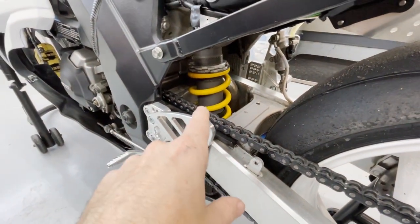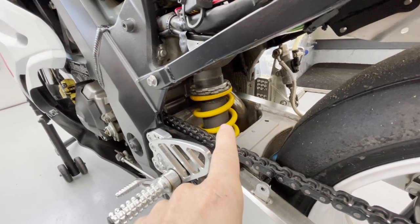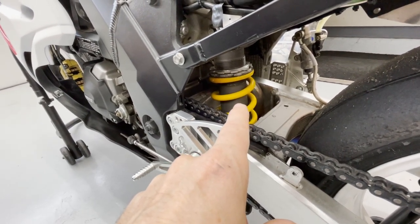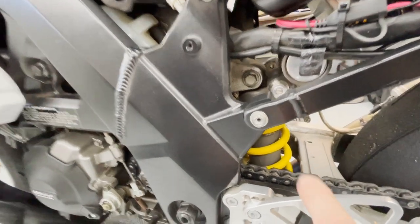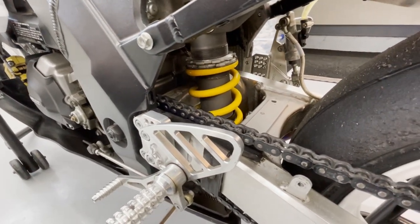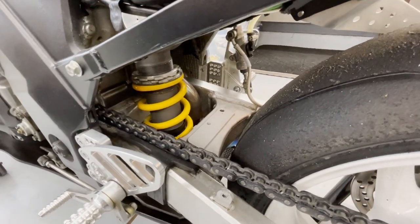To complement the front suspension upgrade, I went ahead and upgraded the rear suspension as well. This is from a 2004 GSX-R 1000. I know a lot of people use ZX-10 rear shocks, or go fully to Ohlins or Penske. That's great, but for the pace I'm at, these stock replacement units work great. You've got compression and damping adjustment with the external reservoir. It's great for really fine-tuning things, and the main reason for wanting to do that is to prolong the life of your tires. You can really chew up a set of tires in no time with the wrong suspension settings.